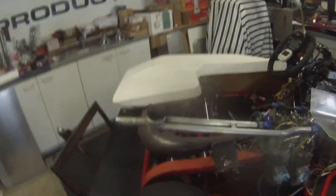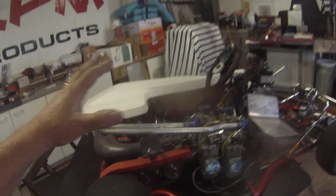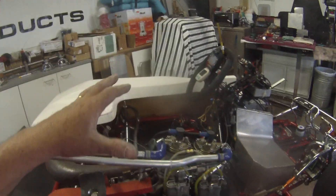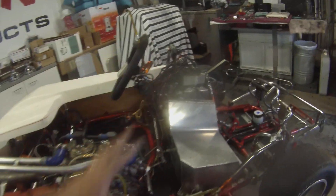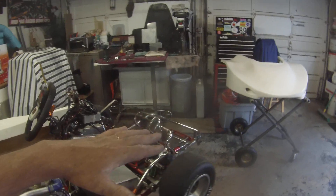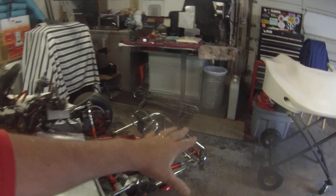We're making progress — day two. Got to get these side pods on. Not worried about cutting around a pipe or fitting in the air box yet, just getting them in place. We're going to need Nerf bars to mount these things so they're solid. Then we'll get them in place enough to where we can get the nose fit up to it, make sure we've got the pitches right. We've already set up everything in a front neutral, and John's given us a dimension from here to the ground as a starting point. We'll make sure there's no yaw, that it's straight and fits both pods correctly. That's going to dictate exactly where the front of these things sit, because they're formed — it's got to fit together the way it's molded.